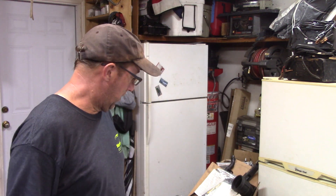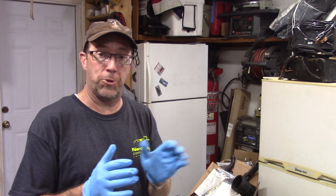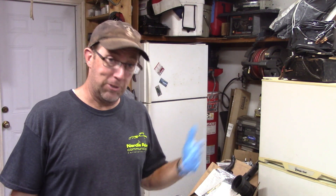Here in the garage I've got some parts laid out on the table. We just did an M50 swap on one of the E30s we run, and we want to add an oil cooler. The 325i E30s came factory with an oil cooler; the E cars did not, and those cars used a fairly normal sandwich-style oil cooler adapter. The oil filter is on the passenger side — it's pretty easy to add an oil cooler to those cars. We've had them on both cars. One M20 had stock exhaust manifolds, one had a header, and that car with a header — the oil filter is a pain to change because it's under the header, but still manageable.